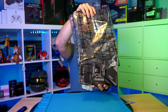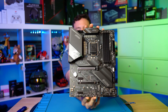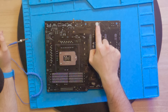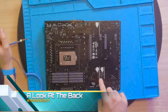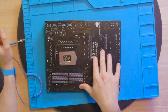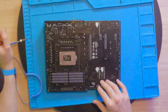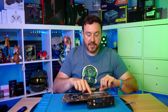To take the motherboard out of its tray, I always try to find the I/O shield — that is a very bulky and strong point on the motherboard, and also the heaviest point. If you get a hold of this part, where the I/O input/output ports are, you're grabbing the most solid portion of the motherboard. Most of these bags are sealed — a simple utility knife opens it right up. Note: I am grounded. And there you go — that is what this MSI motherboard looks like.